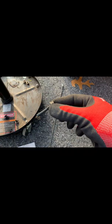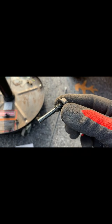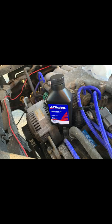You're going to want to go ahead and dip-a-roo. There are two lines on the drain bolt dipstick. One's a low line and one's a fill line. The top one near the top of the bolt is the fill line. It's hard to read, but I was pretty low. I was at the low line.